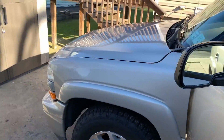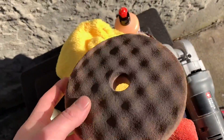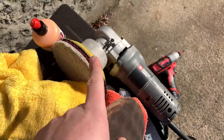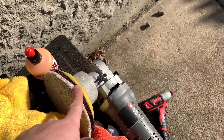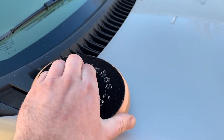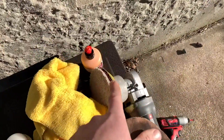One thing I want to touch on quick is the buffing. This orange pad I used just from doing the roof — it's absolutely disgusting now, so I'm not going to go around the body with this. I only have one orange pad, so I'm going to be using this Meguiar's microfiber DM6 pad — it's like a paint correction pad — with the same correcting polish, and I'll hit the whole truck with that. As far as applying pressure: this is a dual action buffer, meaning it rotates and spins, so you really don't have to worry about damaging the paint. It's not like a rotary. A rotary buffer is pretty much like a grinding wheel — it just spins, so you could do damage if you keep it in one spot too long because it'll heat up that paint. With the DA, it's spinning and also rotating, so it is very, very difficult to burn your paint.